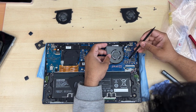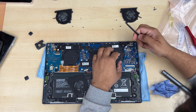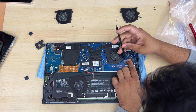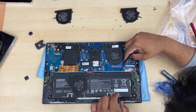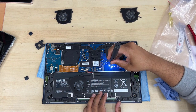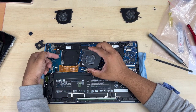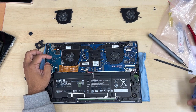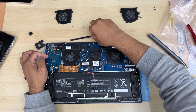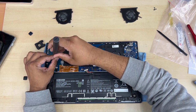This sort of replacement you can do yourself at home. It might look difficult because the machine is expensive, and you might be thinking, 'What if I damage something? Let's take it to the shop.' But believe me, if you love doing DIY, you can do this — the replacement is so simple and easy. Put the fan in place, take a plastic flat opening tool, connect the flex cable properly, close the latch, put in the three screws — done.